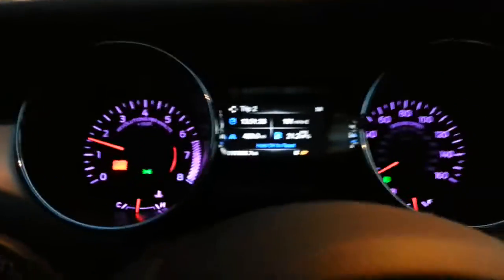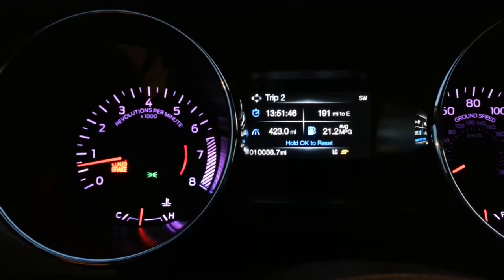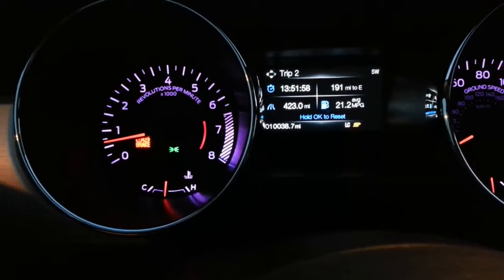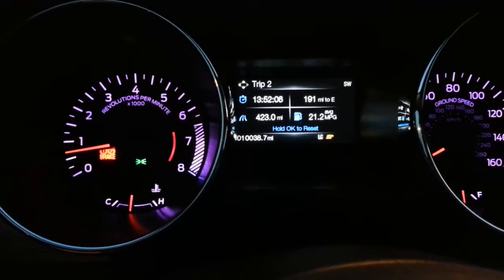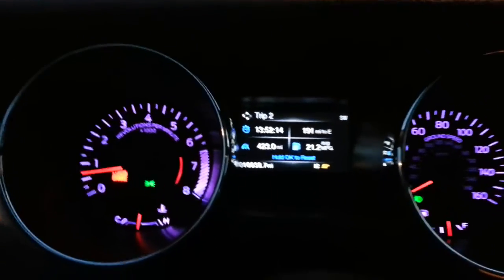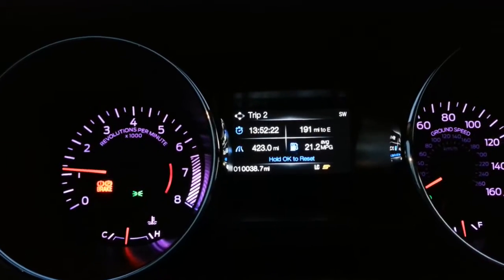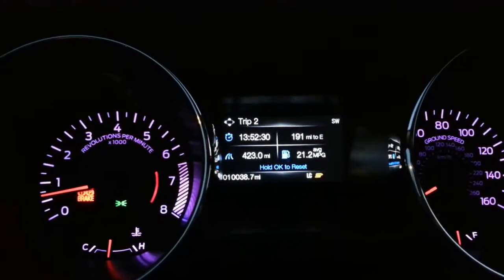But you also have to understand that when you shut the car off and then you go driving, you'll notice the LC disappears. When the LC disappears, you'll notice when you come to a few stoplights, all of a sudden it'll pop back on. And it's basically because I believe the drive cycle is looking for that particular neutral, clutch, first gear, brake order. So don't be surprised if you go to step on it and it's not working, especially when you first roll up to the trees, that it's not enabled. It's because you have to put the car back in neutral, step on the clutch, put it into first gear, hold the brake all the way down, and then let off, then go ahead and floor it. It won't work any other way if you don't do that. It will figure that you're just doing normal everyday driving, and it will ignore it. And then, of course, you'll look like a putz on the strip or in front of your friends when you're trying to show off because you've blown your motor or whatever.